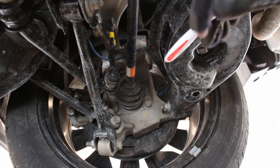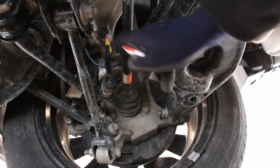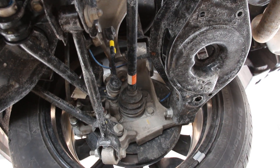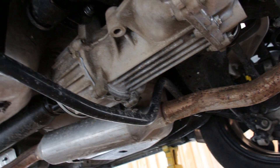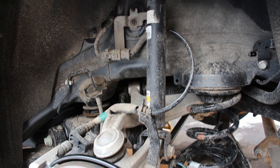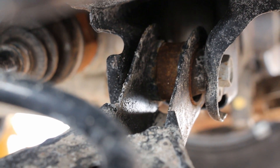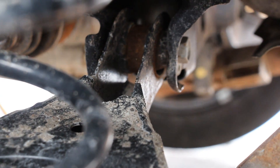Here's a look at that multi-link suspension from underneath. You can see we have the two lower control arms here and the stabilizer link that attaches to the upper control arm and then goes over to the sway bar on the other side. That sway bar has to dance over the exhaust and underneath the differential before going over to the other side. One common issue is that the shocks have to be replaced due to clunking coming from the rear suspension on these new Altimas. Can you imagine how much rust you'd have to encounter to push that bushing out on this control arm? It seems like an afterthought to use steel on this lower control arm.